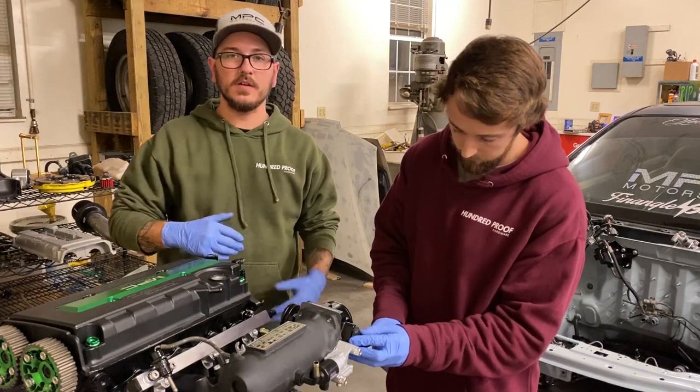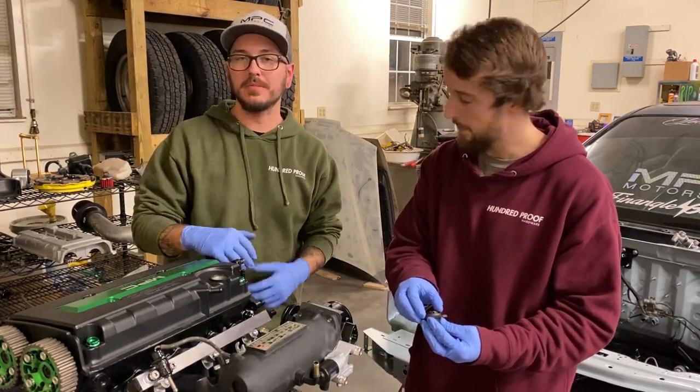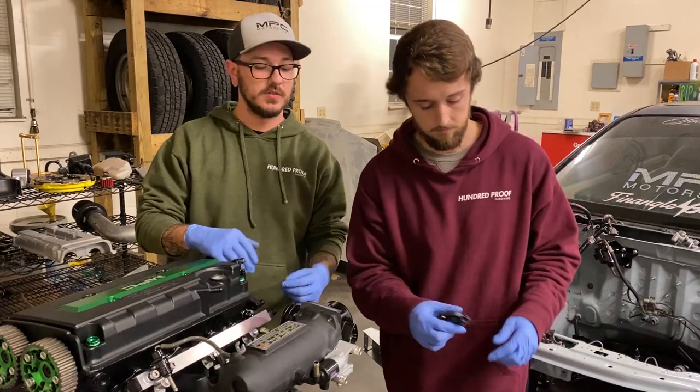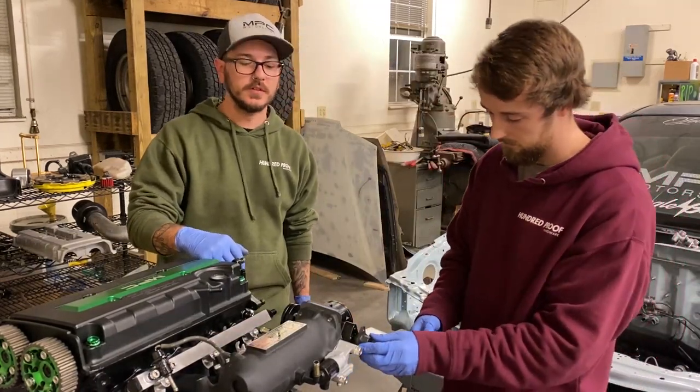Yeah, so instead of looking around trying to source together a new TPS, one that might be compatible, we're actually just gonna head on over to the shop and see what we can fab up as far as a small spacer goes. Because there's only a small 16th inch of a gap, so we should be able to fill it pretty easily.